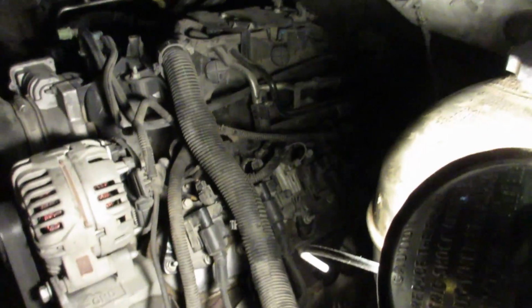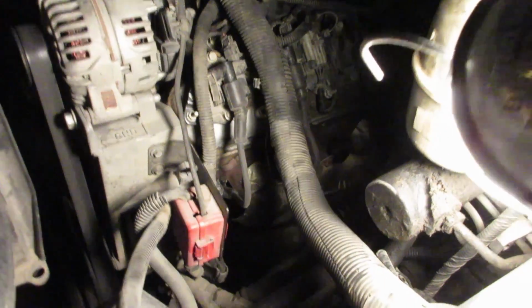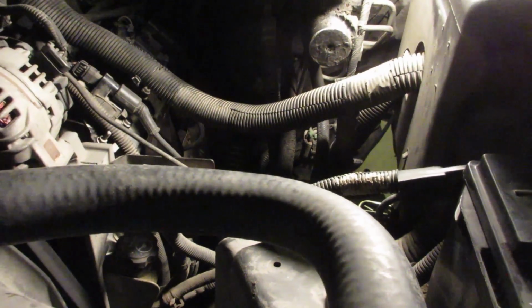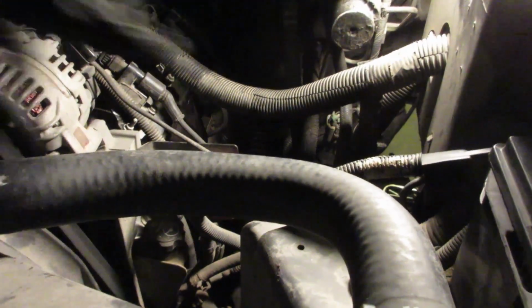So I guess we'll start it up and make sure she's not making a bunch of noise, make sure she don't go kaboom. Maybe she'll even idle smoothly, who knows. We shouldn't have any exhaust leaks. And what else? Grounds in the back of both of the heads are there. New plugs, new wires, same coils. Like I said, I swapped the K10 coils on here and started it, and it was kind of the same thing, but we got a new flex plate up in there. So let's see if she starts up and pray for the best.